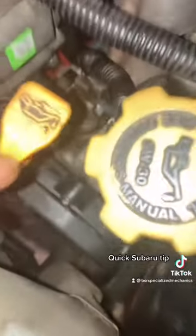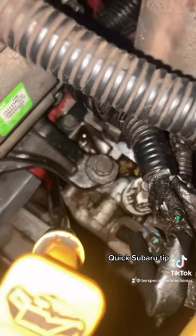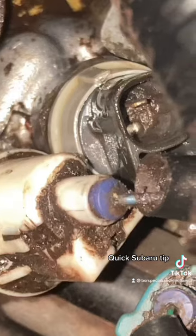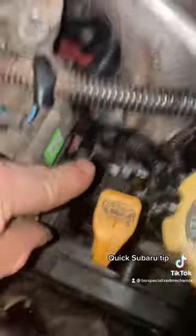Just came back from a test drive here, and I see that I got a little bit of oil pulling up. I started jumping the gun thinking that I did something wrong, but actually we have an oil pressure sender sensor that sits right next to the oil filler neck. And it looks like it's leaking right through the sensor itself, pulling up on the top, dripping down, and sizzling on our exhaust.